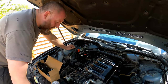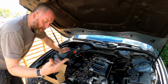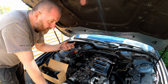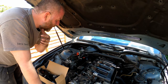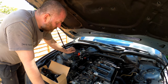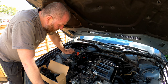Sometimes you will find on earlier versions of these that there is actually just like a bit of sponge in there. What that sponge does is trap the oil and stop it going back into the inlet manifold. But obviously, over time, those little bits of sponge break down and get sucked into the inlet manifold — they're just horrible. BMW did actually replace those with these kind in later iterations, so that's worth bearing in mind.